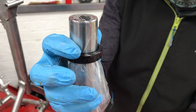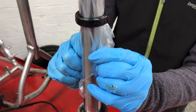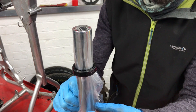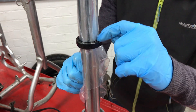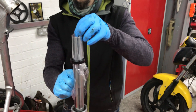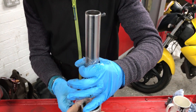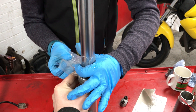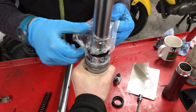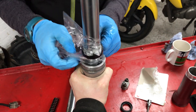We've got this sleeve fork seal, and this little nifty trick of getting the plastic cover over it so that if there are any rough spots or nicks in there, you're not going to cause any damage to that seal that you've just got freshly in place. Now we've got it dragging this down — oh, that's just filthy. Then we'll hold it Kieran while you deal with this.